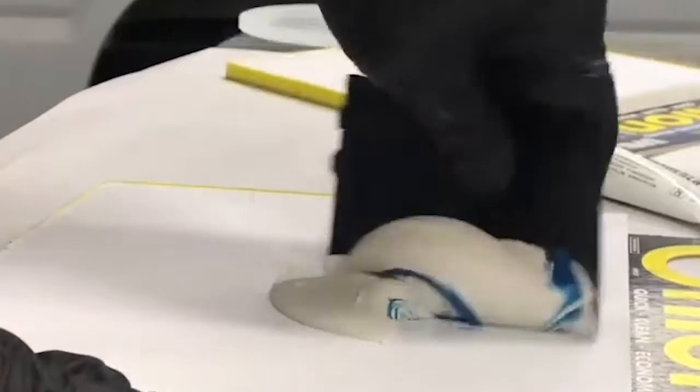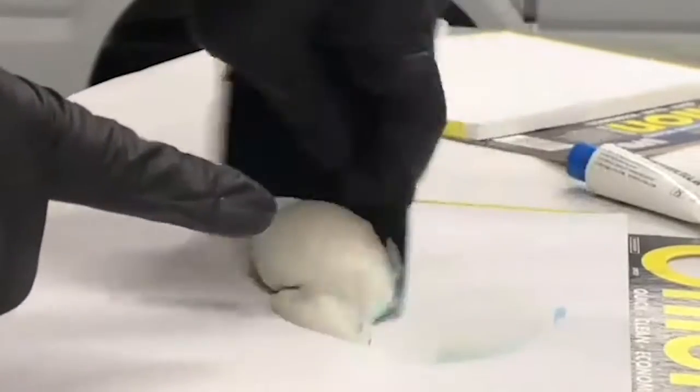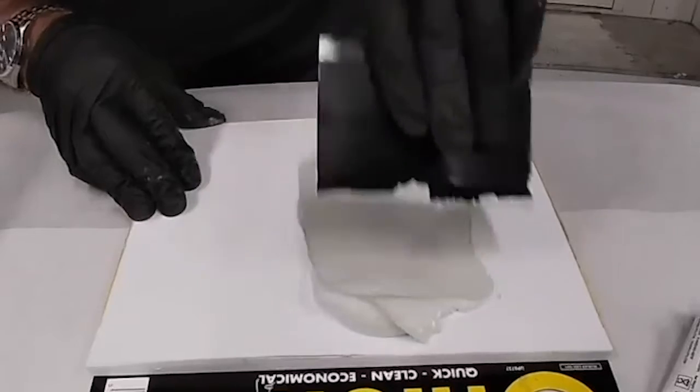How can we prevent this from happening? Only use the recommended hardener for the polyester body filler or glaze that you are using, and make sure they are not defective and are still within their shelf life. Fold when mixing, do not whip, and after mixing spread the material out in a thin layer across the mixing board to help increase the gel time and also release trapped air.